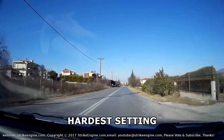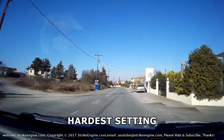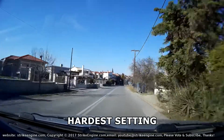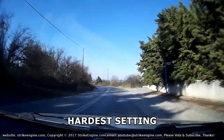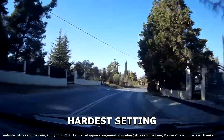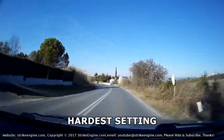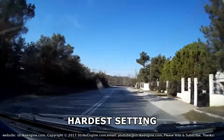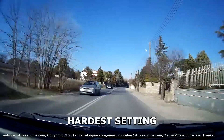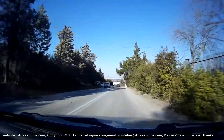It seems like there's less roll, and maybe I'm equating roll to grip, but the front end doesn't seem to want to dig in as much — it seems to be washing across the surface more than with the soft setting. This is what you'd expect when you harden the front relative to the rear. You're much more aware of the road surface, the car appears to be rolling less, and I'd say I've got less confidence in the front end. The car is bobbling about a lot more — even small ripples come through clearly, whereas on the soft setting you didn't feel any of that.